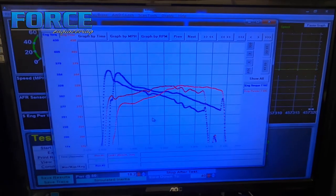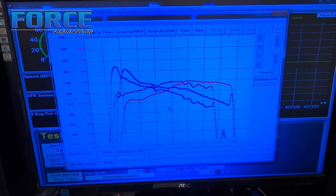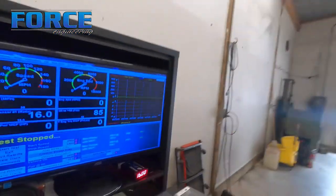Now that the jetting is in the ballpark, ignition timing will have an effect on the AFR. I'm going to start putting a couple degrees of timing in it and see how it likes it, and see what it does to the fuel curve. It is mid-11s now, which is still pretty rich. I'm going to leave it around low 12s because these things travel all over the country — different elevations, different humidity, way different weather conditions. I tend to tune them a little conservative on the fuel so they've got margin if conditions move around. Timing-wise I'll leave it two degrees shy of MBT.